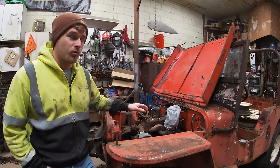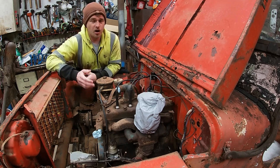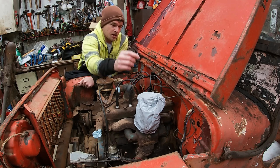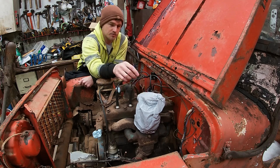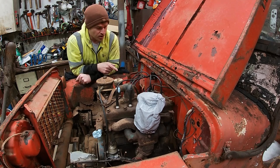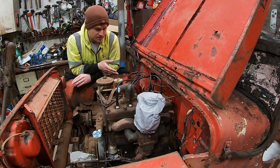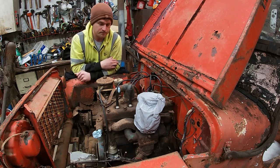To get this little engine running, I've already checked a few things off the list. First was new spark plugs and spark plug wires, followed by a new distributor cap and rotor underneath it. I took the carburetor apart and completely resealed it with new gaskets — there's a rag down inside of it to keep it out of the weather. I also took the starter off, which was another story — there was a lot of debris and rust inside of it, so I cleaned it up and tested it, and the armature will come out to engage the flywheel.